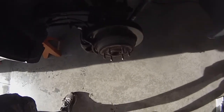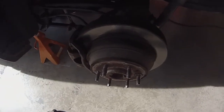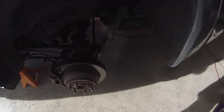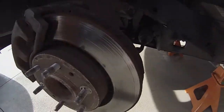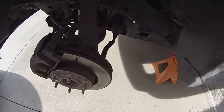His brakes — the camera was on it — the brakes are gone, there's no pad left. The rotors are starting to take an abuse factor here. When you put the brakes on it sounds like a snare drum. Check out the fronts here. They look like they need to be done. He might have a little bit of pad left on the fronts but not much.